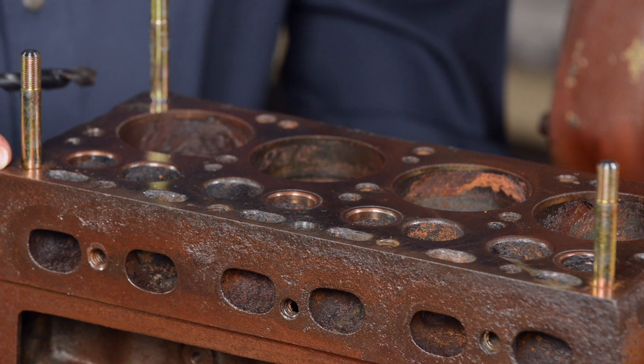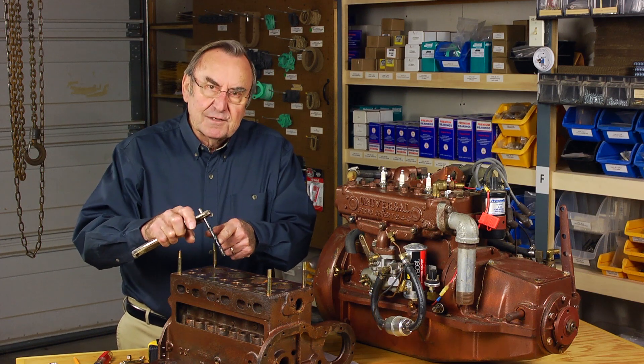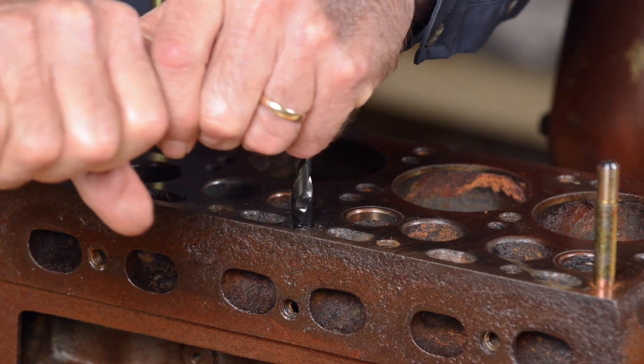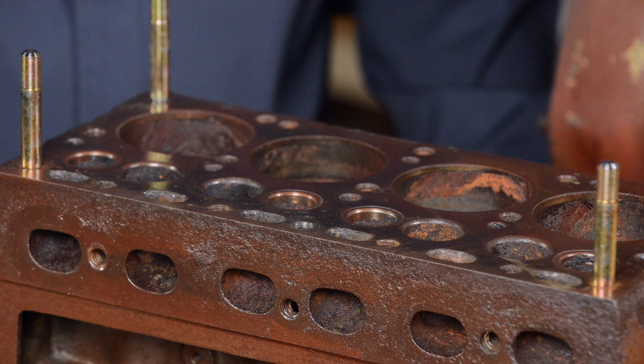However, it's always prudent to take a drill bit and use it as a reamer to make sure the hole is ready to receive the 7/16th inch tap. Now, I need to pause here for an important observation. All of the stud holes in the top of the block go into a generously deep water jacket, except for the one on the manifold side of the engine. Those holes only extend down approximately 1 inch before they encounter the bottom of a water jacket. So on these holes, I always put a piece of tape so I can keep track of how deep the hole is going as I ream it to the proper depth. You can see the tape being reached at that point. I'll remove the debris, and that hole then is ready to receive the 7/16th inch tap.